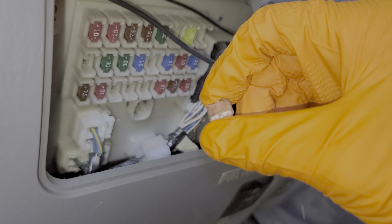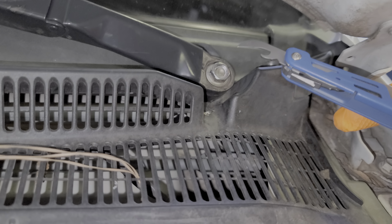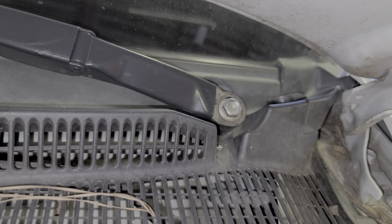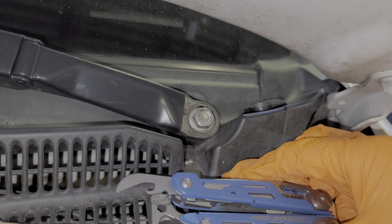This problem is most likely to occur after a lot of heavy ice buildup. We've got our driver side and passenger side wiper arm — let's say the driver side arm is not moving. What we can do is pop off the cover here and inspect this nut. Sometimes the nut will get loose or the wiper arm itself can strip. I believe it's a 15 millimeter. So if you pop off this cover and see that the arm is not moving but the centerpiece is moving, then you may wish to tighten that down.